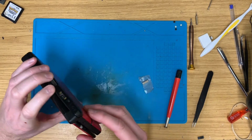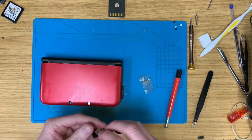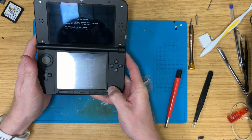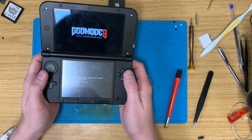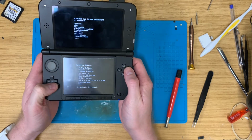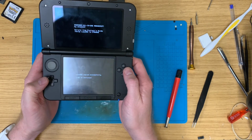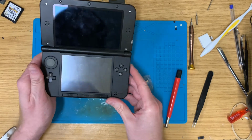So take the memory card back out. Take NTR boot out. And I'll go and put some more firmware on this. Now I should be able to pop that back in. I'm going to have to force power it off, hold down start, power it back on. Yep, into GodMode9. Home, scripts, GM9 mega script, scripts from Plailect guide, set up Luma to CTR NAND. Lovely. Start to reboot.